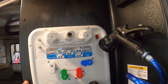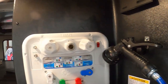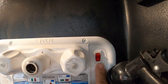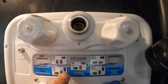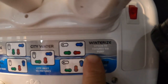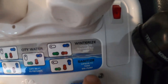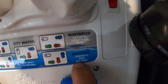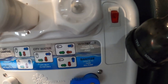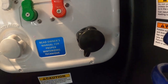All right, we're all set with power and water. Continuing here at the docking station, we've got a hot and cold shower with a quick connect hose, cable or satellite connections, water pump for your fresh water, city water, power tank fill, and dry camping settings. That's also how you set it for winterizing — make sure you bypass your hot water heater inside first, that'll be in your owner's manual. Same thing for sanitizing — all that does is siphon soapy water into your tanks to clean them out. Also here: black tank flush — we'll talk about that when we dump our black and gray tanks.